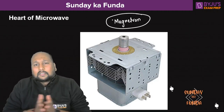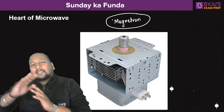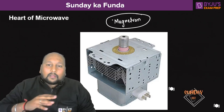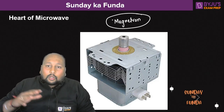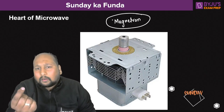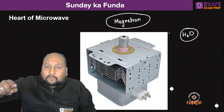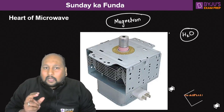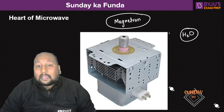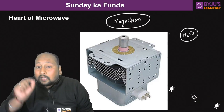A common question is: what is happening compared to a conventional oven? Normally, when you cook any food conventionally, the outer surface gets high temperature while the inner part is not yet cooked. In a microwave oven that problem is overcome because the magnetron releases microwaves that penetrate through the food. Inside the food we have water molecules — H2O — and because every food contains some amount of H2O, and it is dipolar in nature, it gets energized and de-energized by the wave, so every element inside the food receives energy.